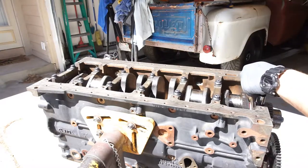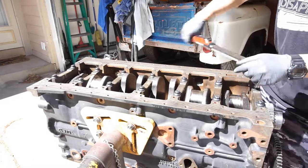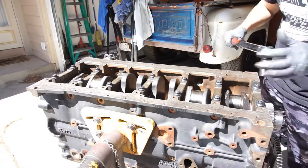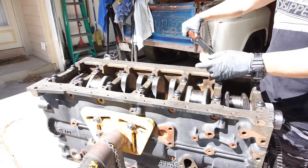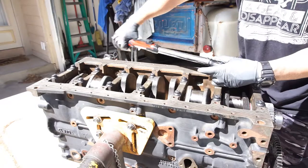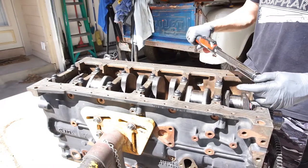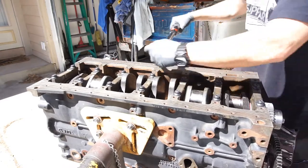Don't mind that. 15 on your socket. So I'm trying to say, I'll go 45. Well, I guess I didn't do these ones well. Skipped ahead. 45. I'll go 45, 90, and then I think it calls for a 125 or 150 for the final. I'll check them all. So they're all good.